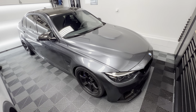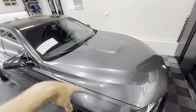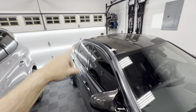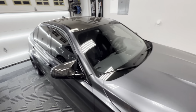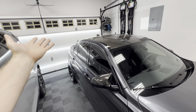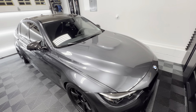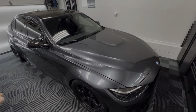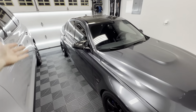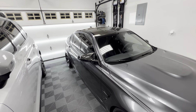It sounds really good, but my main gripe with the current setup is the ARM Motorsports resonated catless downpipes and an In Customs catback, consisting of a resonated mid-pipe and a muffler delete with an anti-drone muffler. So essentially, I have resonators in the downpipes, a resonator in the mid-pipe, and a resonator or muffler out back. So 3 different sets of resonators that are really quieting this down and holding back what I think could potentially sound very good. Since I love the catback that I have from In Customs, hand-built in Germany for my specific needs, I didn't want to mess with that since I think it's a really nice setup.